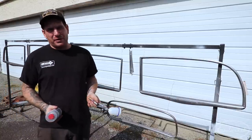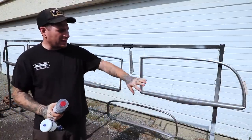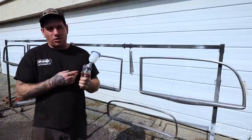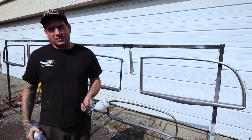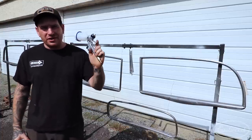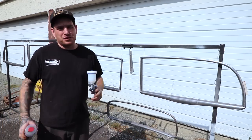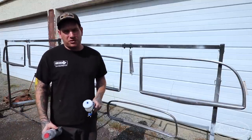Now that I have it down to bare metal, I'm going to be using the 2K Aero Spray Epoxy Primer to seal everything up, and I'm going to use my little Eastwood Pro detail gun to spray this. I used the larger gun when painting the dash because it was a wider area, but with something like these garnish moldings, we'd be wasting a lot of paint using a full-size gun. The little jam or detail gun is much better for jobs like this — we can use a small tip and get coverage without wasting a ton of paint.